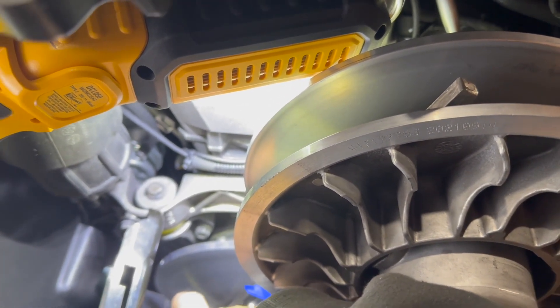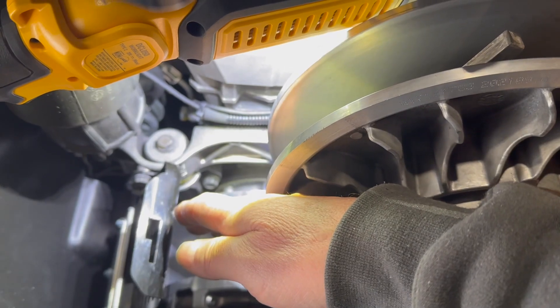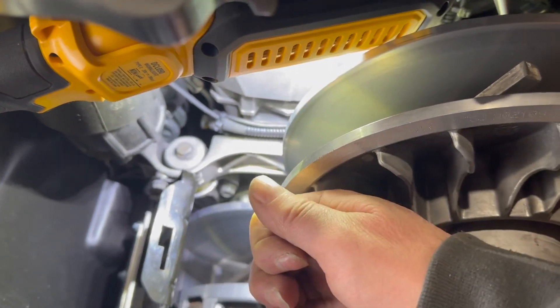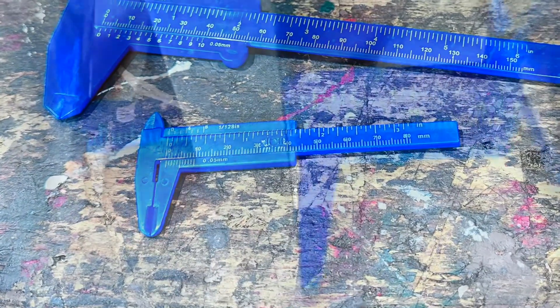It's pretty tough to get the measurement on the bottom. You have to have a really small caliper, or it's really easy if you have the side bottom pan removed. With a small caliper I was able to get down in there, and I ended up with about 43.2 millimeters at the Y location, which is right within spec.